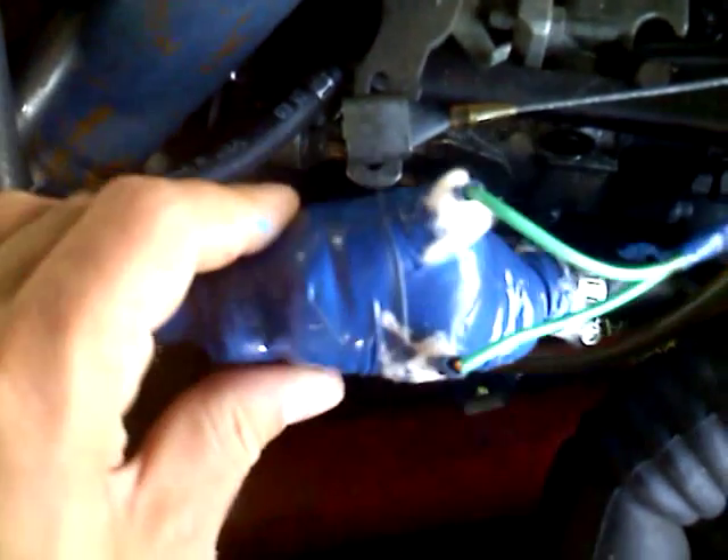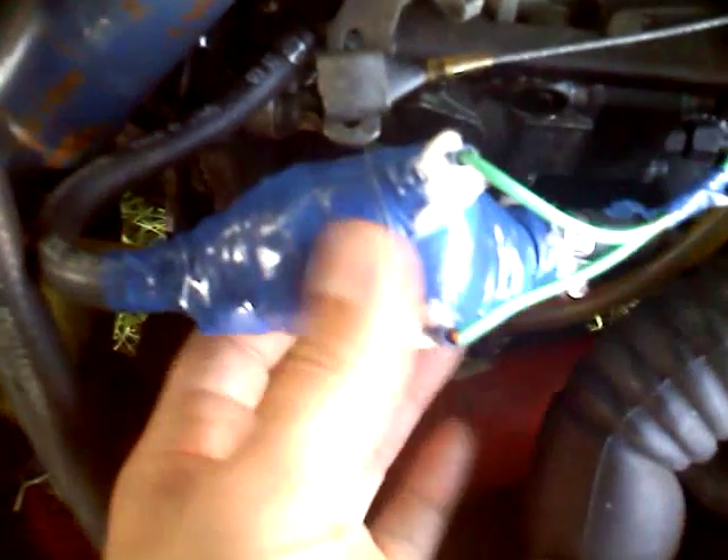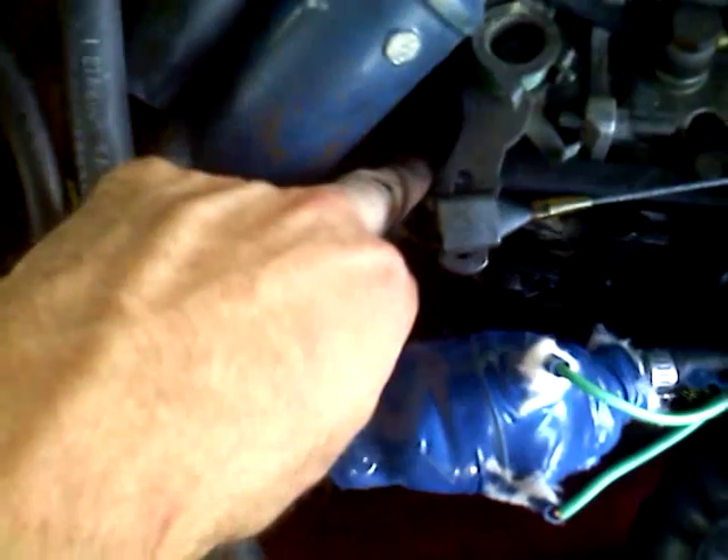Then it goes into the second heat exchanger. This T here is for looping the fuel return, so that you don't send vegetable oil back to your diesel tank. The second heat exchanger is after the three-way valve, so all fuel goes through this heat exchanger, heats up, comes through. And this here — I've got rapid insulation and tape — is my temperature switch, which automatically detects the right temperature of fuel for switching to vegetable oil. Then that goes into the injection pump.